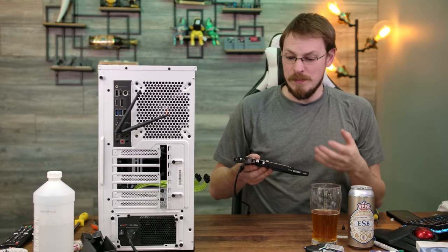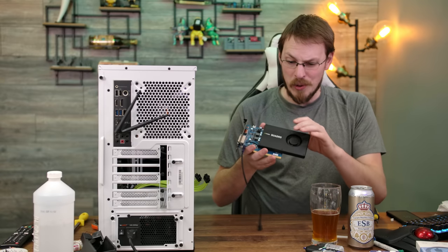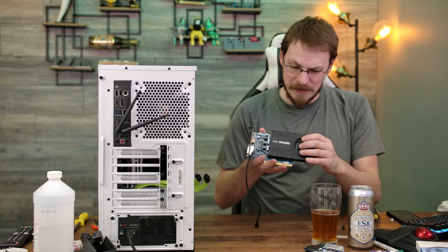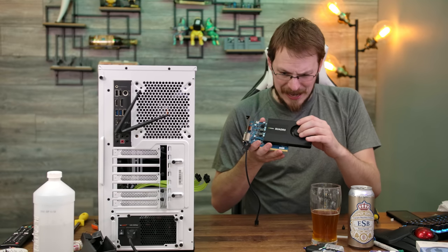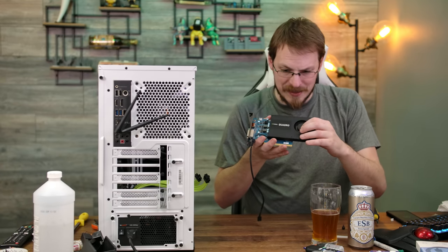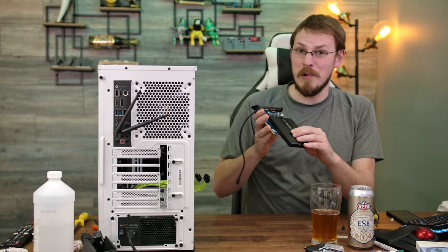What I am worried about is, is my solder job on the crystal oscillator good enough? And there's also that capacitor near the back of the board that I cut out the hole in the heatsink for. Apparently I didn't have quite enough room even with notching the front of the heatsink because it's pitched off at a pretty good angle and I can see the bottom of it has lifted off the board slightly. Now the pin itself is not broken and it's still going through the board, but that may present me an issue. I don't know, and we're about to find out.